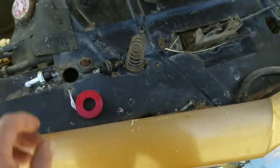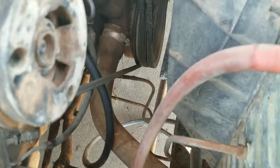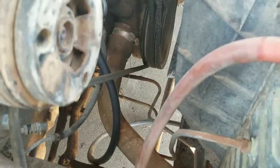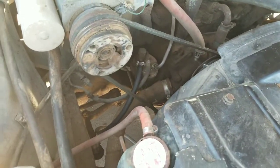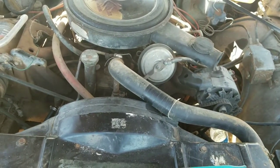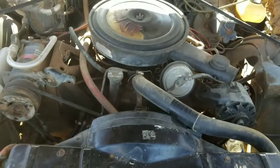What I'm going to do today is put a fuel filter right off that hard line coming out of the tank, then dump some fresh gas in the tank along with some B12 Chem Tool, and see if I can get this thing to run off its own tank. I'm putting the extra fuel filter there because I don't want to suck a bunch of crap into the carburetor. The carburetor has a fuel filter too, but a little extra protection goes a long way. I'm gonna go get a couple more gallons of gas and mix it with the old gas and the Chem Tool, and we'll give it a shot.